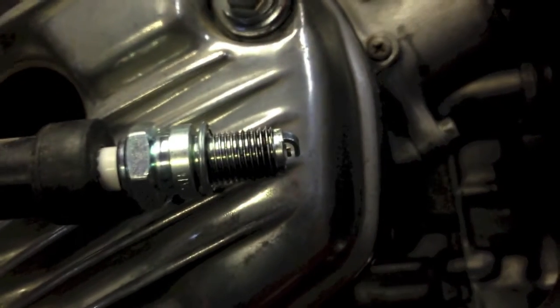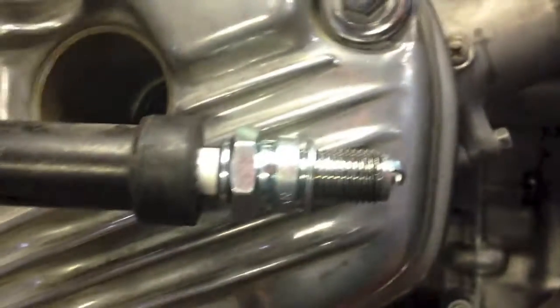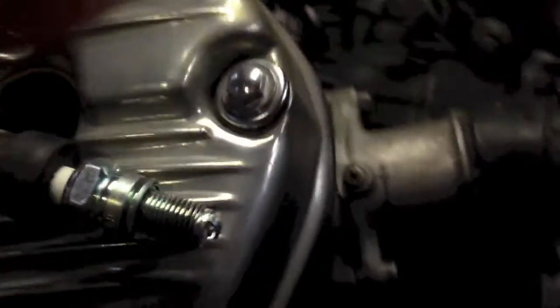Let's go ahead and push that button and hear that wonderful sound. It turns over — the starter's turning — and just to make sure that we're getting spark, let's focus in on that. Little bits right there. The battery's at about 8 volts right now so we're not getting a whole bunch, but we are getting spark, which is a wonderful, wonderful sign.